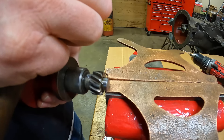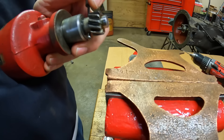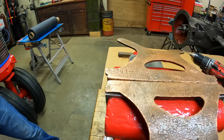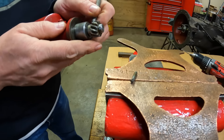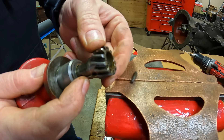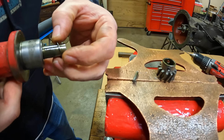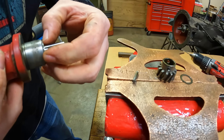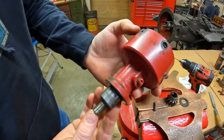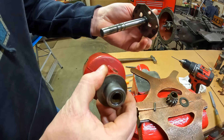That should be enough now to drift the pin out. Right there - I was hoping to have caught it, there it is. Now the gear should just come right off the end of the shaft like that. We will have a couple of washers on the end - very thin one. You definitely want to keep track of all these as they gauge the end play. There's a thicker one. And we should now be able to simply push the shaft right out the top. There we are. Everything's looking good for the most part - so we have a disassembled distributor.